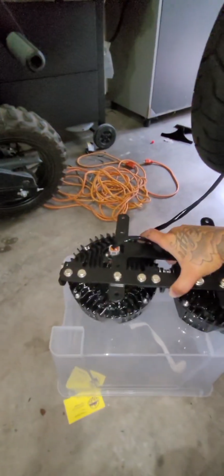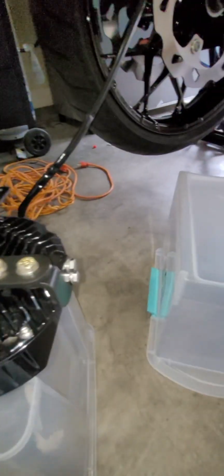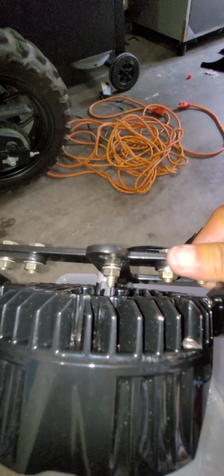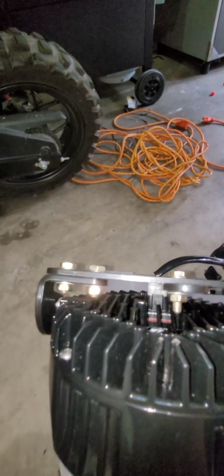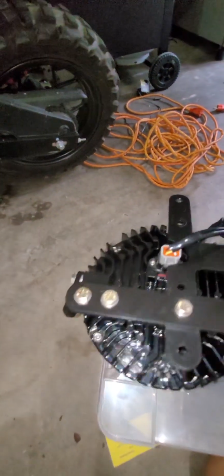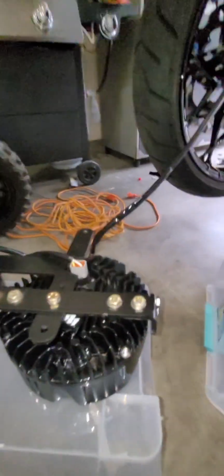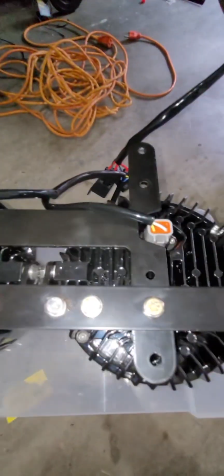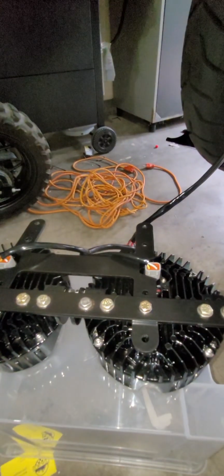And then once you get those side ones on there, then you can start attaching the back piece to the H bracket. And remember, the bar goes on the back side. Okay, and then I just obviously use a ratchet and a 7/16. You want to make sure that you plug your plugs in first. Don't get the bracket in there, get all the lights in here, and then try and plug the plugs in, because it'll be a pain in the ass.